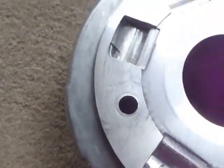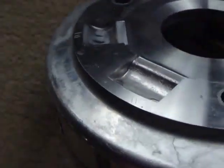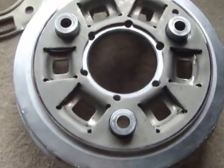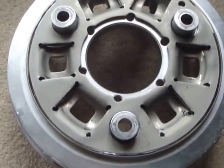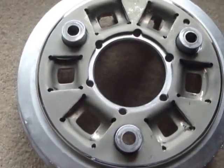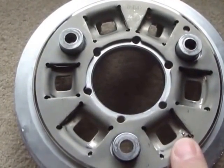The manufacturers leave them like this and the bike will probably do 50,000 miles and you'd never know there was a problem. When it comes to the larger capacity engines — particularly large singles, V-twins, 1000cc V-twins — that give their clutches a hard time, this damper has to be much stronger. And this is the one from the Suzuki SV-1000 and DL-1000 V-Strom.